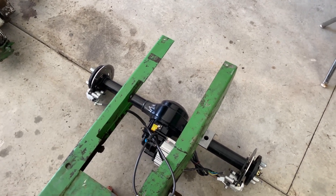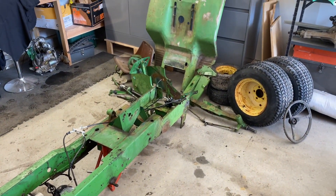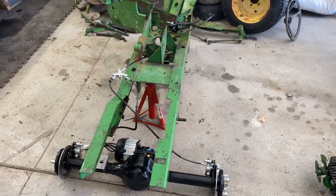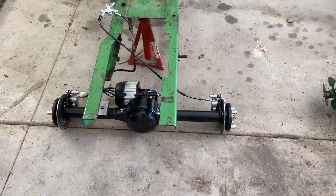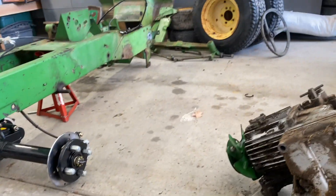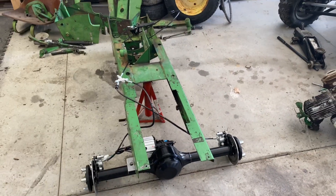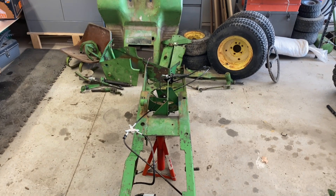I also received a different motor — a 48-volt 1500-watt versus the original 48-volt 500-watt, which is a big difference. I still need to figure out the battery situation: right now I have 48 volts of lead acid, but I want to go to lithium polymer or some type of lithium battery. One other issue is the hubs — the new axle has four lugs and the old rims had five, so I have to figure out how to mount those rims. Lots of work to do — subscribe if you want to see the rest of the series.